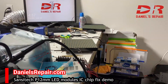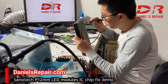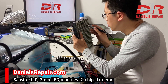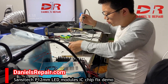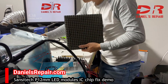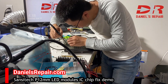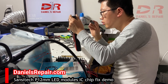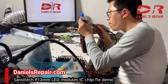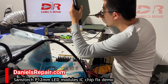As you can notice on the monitor, it costs about 10 to 12 minutes to do this process. After the IC chip is fixed on the PCB board, this is not the end of the process — don't forget to put some black silicone glue back to make sure it is waterproof, and then put the cover and screws back.